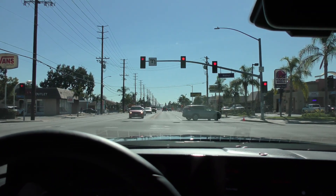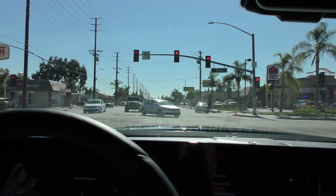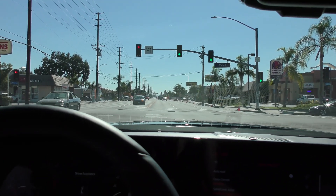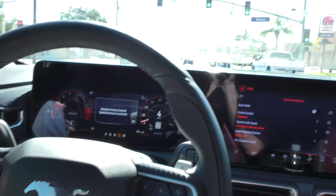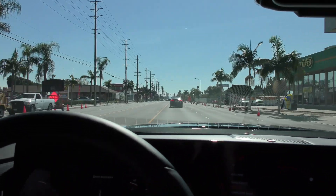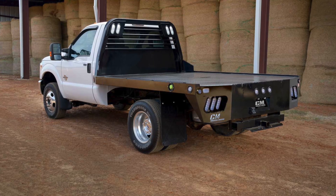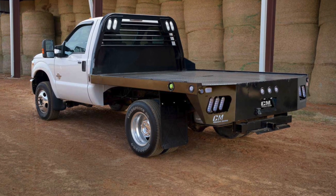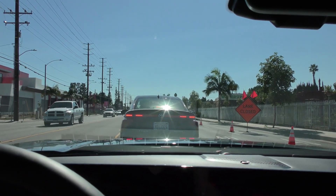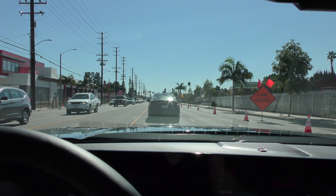If it's raining really hard, snowing, or icy, I'd recommend not using adaptive cruise at all — you want to be paying as much attention as possible under those conditions. Also, keep in mind the shape of the vehicle you're following. The example I always use is a flatbed delivery truck with nothing on the bed — are you locked onto the actual bed or the back of the cab? If you're following a weird-shaped vehicle and it seems like you're too close, take manual control.